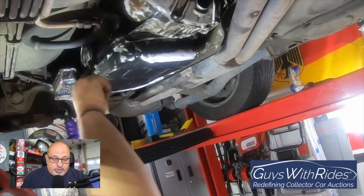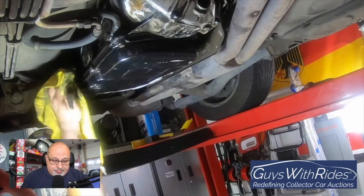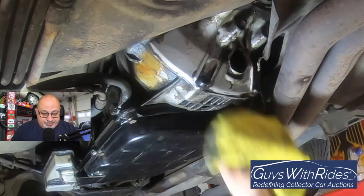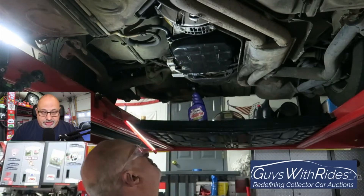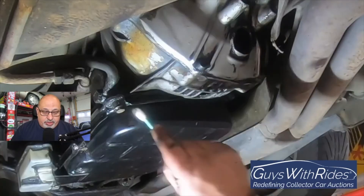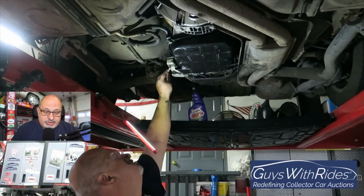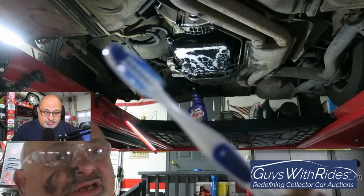Continuing to work, I'm actually using a brass brush there to clean it with a microfiber towel, but I was careful not to use the brass brush on the pan itself because that's a painted surface. To the left-hand side, that's actually a plastic case — that's the reservoir you use to fill the pan with. You can see the torque converter tube in front of it is cleaning up well. I'm also using a photography brush that you can order off Amazon — that's what you use to clean photography equipment. Look at how clean the torque converter is just ahead of the transmission now. Pretty amazing how that came up. Just spray, rinse, and repeat.